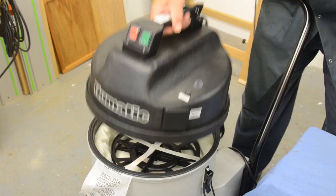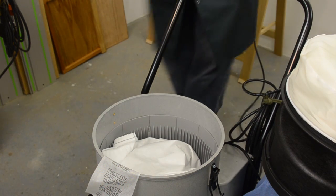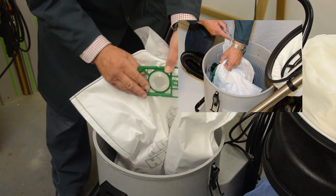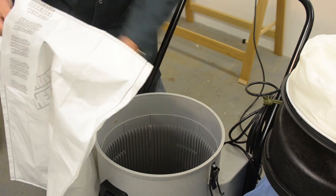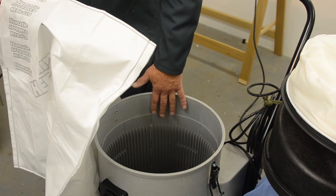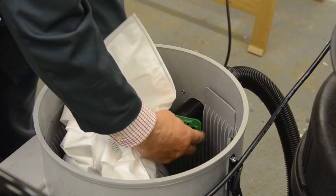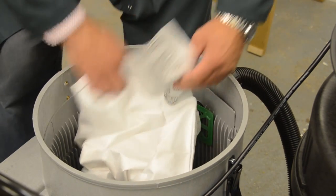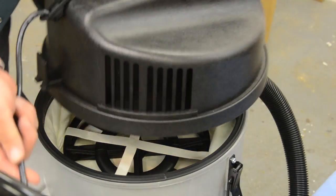Now if we take a look inside — take the motor unit off and put it to one side — you have the main filter, and then you have the bag which is fitted. It fits over an extension of this port on the inside. Here on the inside of the tank is a louvered plastic element which allows the flow of air through the bag to continue even when the machine is working flat out. It stops the bag being pressed up against the side of the barrel. When fitting a new bag, one pushes this rubberized little section over at the end of the box and you get all the way in so it's perfectly set, then have this hanging over the edge which will get trapped when you put the filter back in and the motor unit in place.